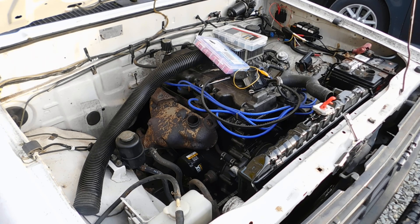My fusible link isn't getting hot. We're still charging the battery. Maybe the battery was just that low, so the distributor wasn't firing properly. Let's see where this street goes — never been back in here. It drives exactly the same as it did before.